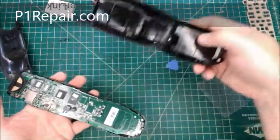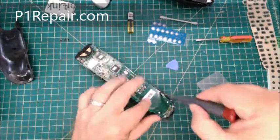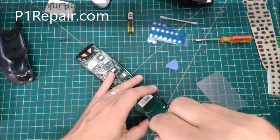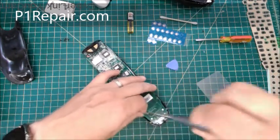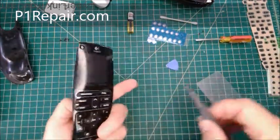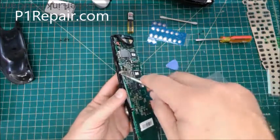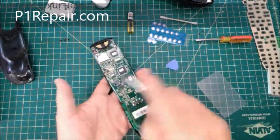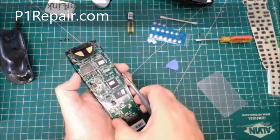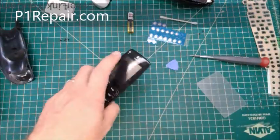And that's it there. Now it starts to get a little trickier. There's 2 screws down at the bottom of the remote, and these are a different size. So I'm going to put them somewhere else to not get them mixed up. They're pretty close, but just a little bit shorter. So now here's where I messed up the first time. I just sort of tried to take this circuit board out. There's a cable right here, and that's for the touchscreen. I tried to take this out and just sort of fold it over like a book, but it got stuck up here, and it just had a little trouble. And when I finally did it, I guess I pulled a little too much. It's very fragile, and it ripped, and now the touchscreen won't work anymore.